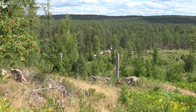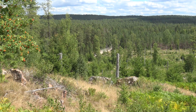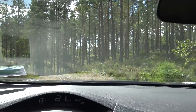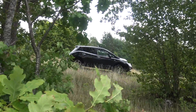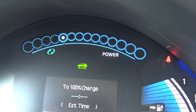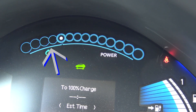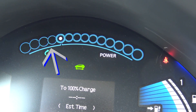Using the braking mode has different characteristics depending on how much braking energy the car can receive. For example, when the battery is full, you will have none or very little braking effect using the braking mode. The car's way of telling you how much braking effect you have from the regenerative braking system is through those rings. As you can see, the rings are not doubled — that's because the battery is completely full and there is no place to put any braking energy into the battery.